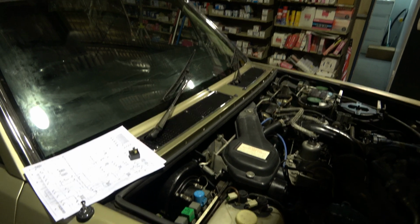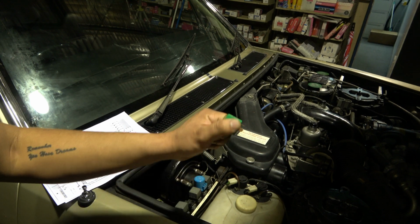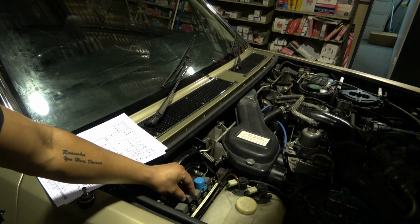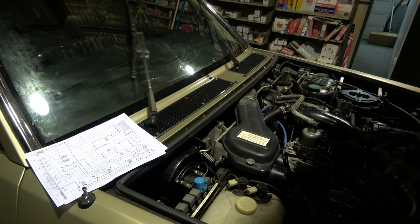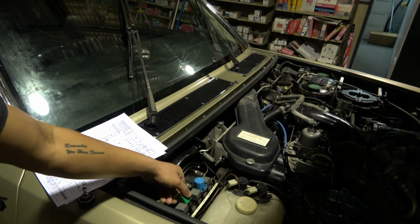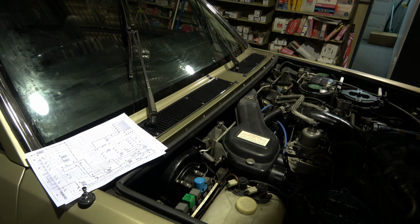Now let's put the original relay back. I'll just take that off, and we'll put the 5-pin original relay, and the switch is at off position. As soon as I put the relay on, the wipers start coming on and do not stop. So I found a little quick fix for a problem like this. I don't know if all the circuits are gonna work the way they should, but looks like it is. But that's my fix for today.